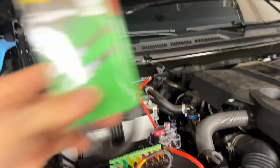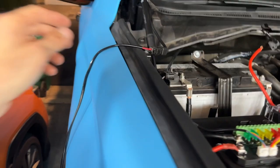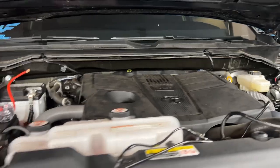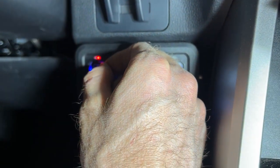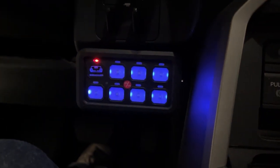So I just got back from Walmart. Had to pick up a few things, including this battery cable, because the one the kit came with — the connector fell right off super easily. All I had was black, so it does work for positive as well. I also removed the wiring harness with the relay and the switch from the cube light, cut it right there, and now we just have a straight black and red wire coming directly from the cube light on the passenger side as well as the driver's side. Now plug that directly into the control box, and then this wiring I tucked behind this piece here, underneath that plastic trim, all the way down to the driver's side, and into the firewall. Put the windshield light on spot number one — boom. Perfect. And it illuminates right through too, so it's got little cutouts. So sick.